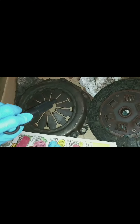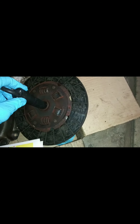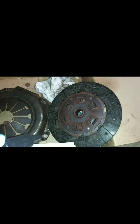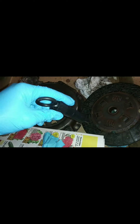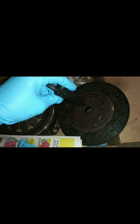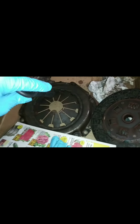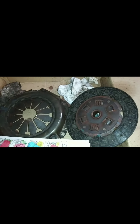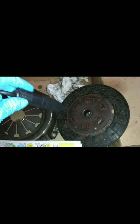There are the six bolts. When removing the old clutch, make sure you use the alignment tool — the clutch plate goes over the clutch disc and you insert the tool so it matches up with the splines, holding it in place until you remove it so the disc doesn't fall on you. I forgot that part, which is why it fell on me. When installing the new one it's the same: clutch plate over the clutch disc, insert the tool to hold the disc straight, and as you slowly bolt it down in a criss-cross pattern, keep rotating the tool to make sure it still moves freely and hasn't misaligned. The tool seats into the pilot bearing slot and you need to make sure it seats completely as you're installing.